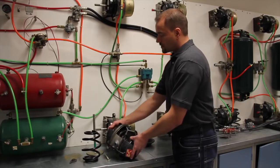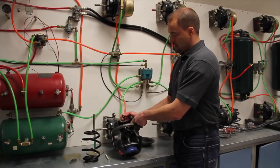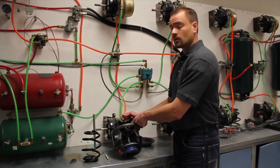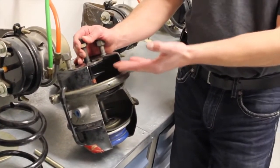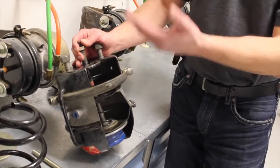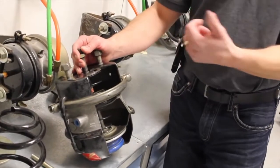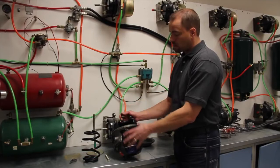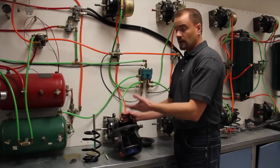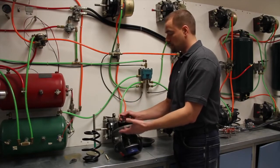With the service side, you're going to have a color on the push rod — some will be red, some will be orange. If you're starting to see red on the outside of the brake pot, that means your brake is at its max stroke and you're not getting braking force. Usually what happens there is: A, brake linings are down; B, something wrong with the interior or foundation brake on the truck; or you're just out of adjustment or the slack adjuster has issues.